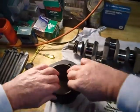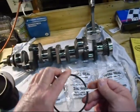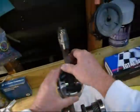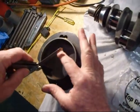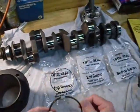It's still a little bit tight so I need to go just a tiny bit more. That should about do it right there. Push it back in, make sure it's squared up — and there we are. This ring is now good for the number one piston.